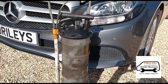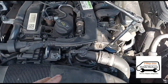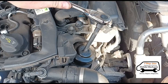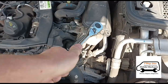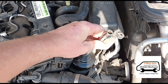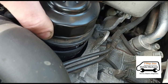On this oil change I'm not going to jack the car up. I'm going to use an oil extractor. I know a lot of people will moan about that, but this is another method you can use and it is exactly how most dealerships do it these days — they put an extraction pipe into the dipstick and suck the oil out. I'm going to open the oil filter now, and once it's loose enough I'll take off the ratchet and give the last couple of twists by hand. Once it's loose I'll let it sit there for a couple of minutes because we'll get drippage, and most of the oil will drain back down.